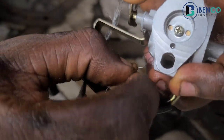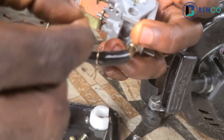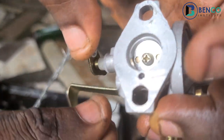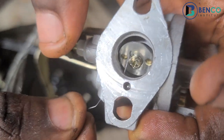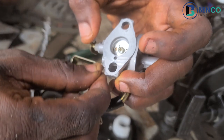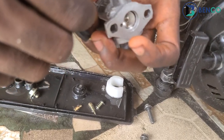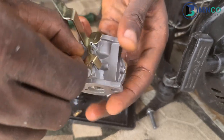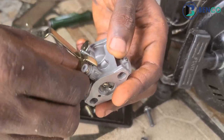Notice carefully — this wire just came out from the other end. That tells you the carburetor pore has been cleared through. Basically, this is what we'll be doing to all the pores. There are some you will see and some you can't see because the camera may not be able to access that angle, but just know that is how it works.